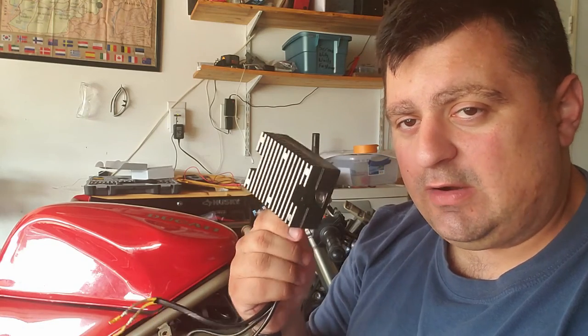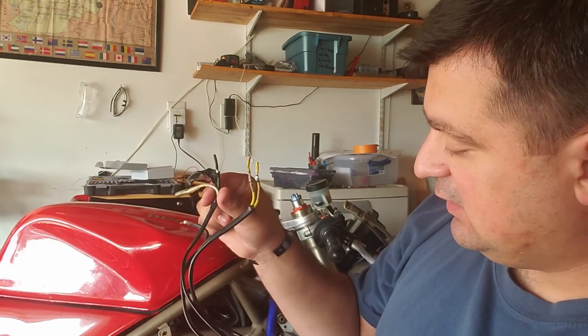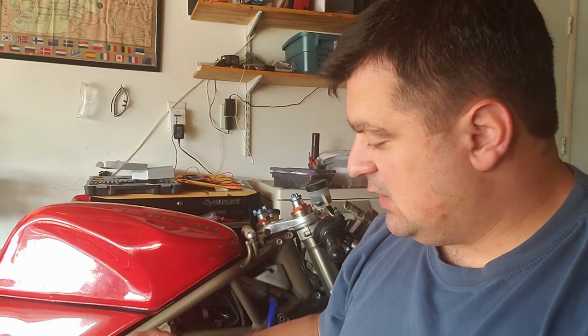So I got one of the techs on for Electrosport, and I was able to kind of pick his brain and explain what was going on and tell him how I thought I had wired everything correctly. And he's the one who actually advised me to do this, and apparently this is a common problem. Now, I will point out that I'm not that stupid. I wired in the new regulator rectifier the same way that this one was wired in. So this black wire, logically, was soldered onto another black wire that went directly to the negative terminal on the battery.